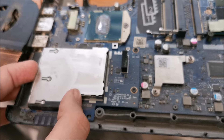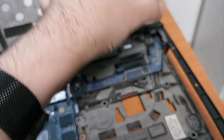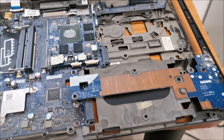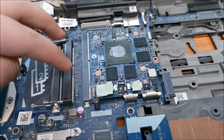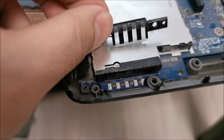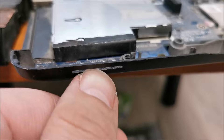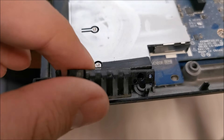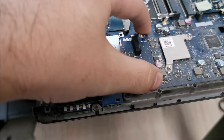Something is telling me there's more hidden corrosion somewhere. But this is not a repair-friendly laptop — it's many, many layers, many screws, a PCB with a weird shape, a protrusion right here, lots of ribbon cables. This is not repair friendly at all. Basically at this point I'm removing all the screws that I can see. I want to try and clean that corrosion, although if I cannot find a fuse or something that's blown... I don't know what HP was going for here. Even this tiny piece — that's basically the light guide, spitting out light in this area. It's really hard to remove. Everything in this laptop is a pain.